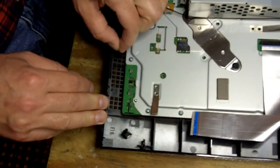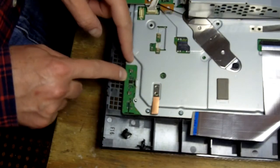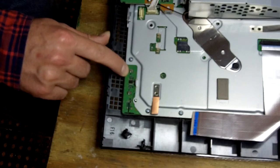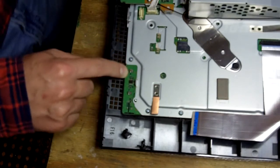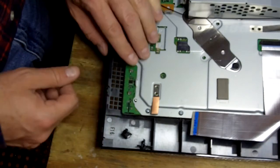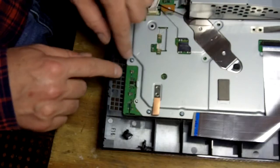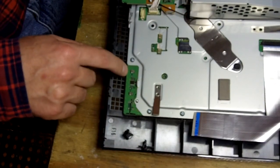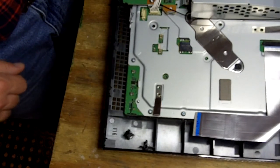Just be careful — pull just enough to get it even with the other button. Usually both buttons aren't smashed. It's probably about an eighth of an inch or so of space between the top of the contact and the motherboard. So just about an eighth of an inch gap there, and you'll be back in business. Thanks for watching.